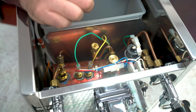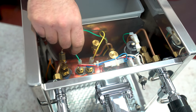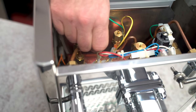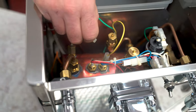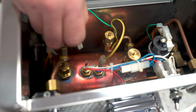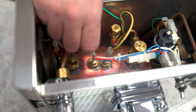The minimum sensor ensures that the heating element only turns on when the minimum amount of water in the boiler is enough to cover the heating element. If you disconnect that wire so the five volts can't pass, the heating element turns off because the machine thinks there's not enough water to cover it. This protects the boiler, the heating element, and the pump, and it doesn't allow overfill — a nice additional feature on most Bezzera heat exchange and dual boiler machines.